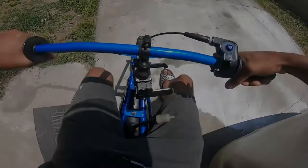What's up guys, it's your boy RoyalJZ. For today's video we're gonna be messing with the carburetor. So on my bike right now I got a 1/4 throttle — that's the race throttle where you only gotta pull it all the way back. When you give it halfway gas it bogs out. I'm thinking it's flooding the motor. The carburetor is already jetted and it never bogged before, so we're gonna be switching the throttle to a normal full throttle and see what it does. I think it's the throttle making the carburetor bog.